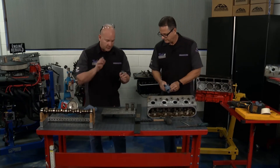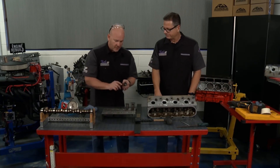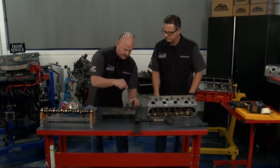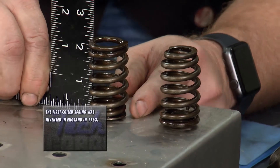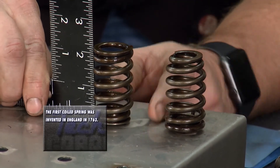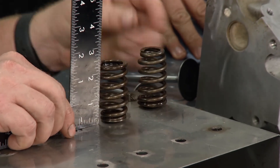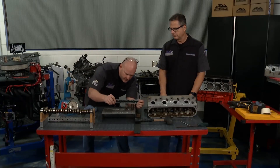Now there's even more to inspect here. We're going to go slow so that ultimately we can go fast with our LS engine. On the valve itself, lots of inspections have got to be done — John's going to show you more about that in a second. But I want to show you how to inspect these valve springs. Believe it or not, these guys can get out of round, they can get out of true, they can get heat cycled. You're looking for — just get yourself a level, a good surface like this. Look for level and true and plumb all the way up that valve spring. I like to roll it around, check it at a few random spots. Same thing on the other one — check for level across the top of them.